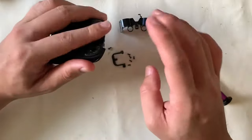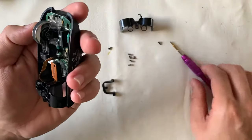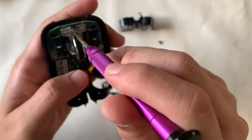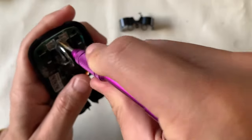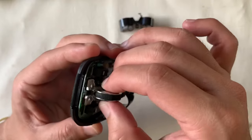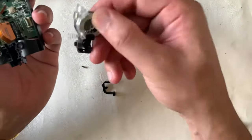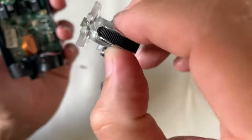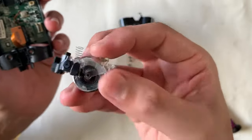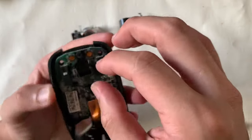The plastic piece securing the mouse assembly comes off first. The tricky part is that the wheel assembly is quite complex. If there's a fault with the wheel, it usually means removing and replacing the whole assembly. What makes the wheel pop up is the big spring. On the other side there's another small spring for the actuator — be very careful with that one because it's tiny and once it flies off you'll have a fun time looking for it.